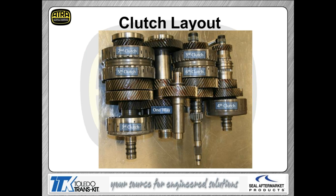The clutches are laid out on the shafts. On the secondary shaft on the left you've got the first clutch, fifth clutch, and second clutch. The counter shaft has a one-way clutch built into it — like any other Sprague one-way clutch, it's directional. The main shaft, third from the right, has the sixth clutch and third clutch. The last shaft on the right houses your fourth clutch. The clutches lock a particular gear to the shaft to give us the desired gear ratio.